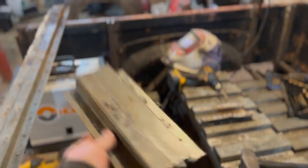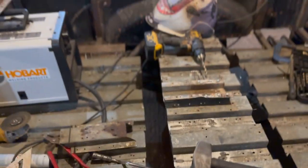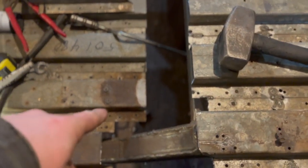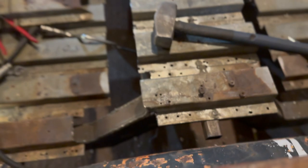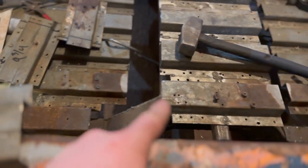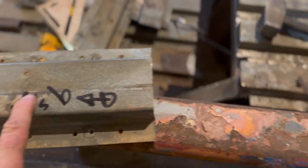Right here — I've got the marking on it. It's nine and five-eighths long, simple straight cut. I know what you guys are going to say: why didn't you do the 45s onto this? Honestly, I couldn't figure it out — my brain wasn't working on it. I had one piece, two piece, three piece, all test pieces, and couldn't get it to work. What ended up working is 45s on the truck-side pieces and a straight cut on my one piece.